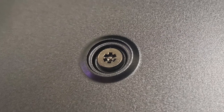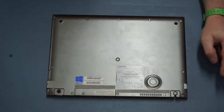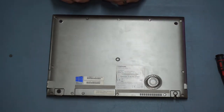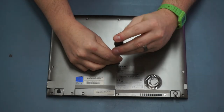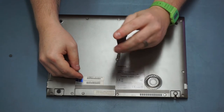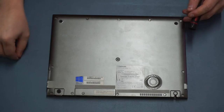Once it's out you'll see there's a security screw in the middle, and this is a real pain to find a screwdriver head for. What I've ended up doing on models that I've had this screw in before is I just use a straight screwdriver head to break off that pin in the center. Then because it's a six-head screw you can get a straight screwdriver bit in there and remove it. I've already broken the center pin off on this one - you'll find a lot of them are broken off anyway. Just use a straight edge screwdriver head to get that screw out, and you can usually do it without causing too much damage. The screw will be perfectly reusable, and the little non-slip cap you can just use a little dab of superglue to stick back on when you're finished.